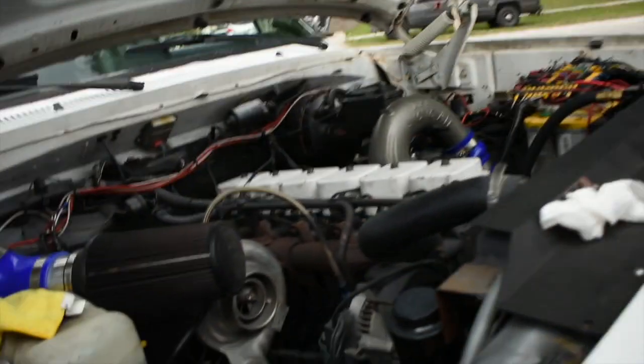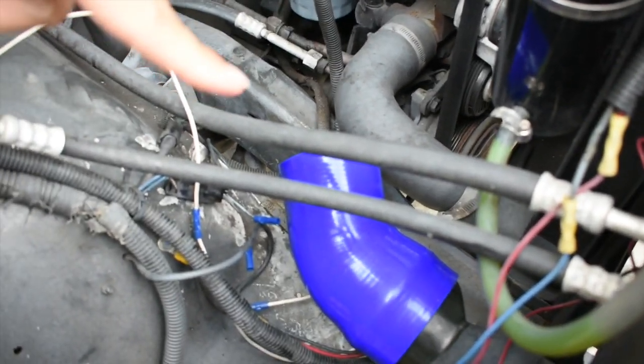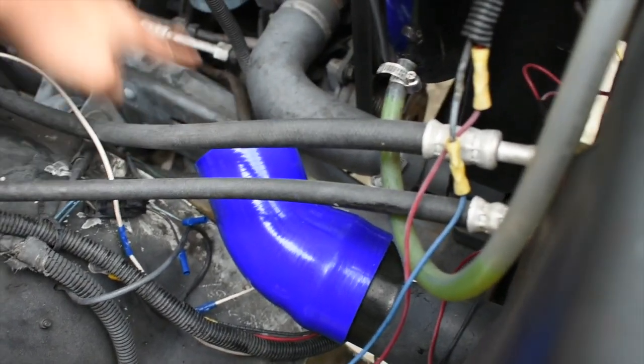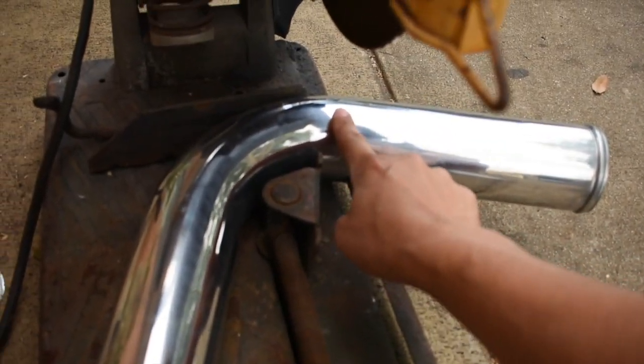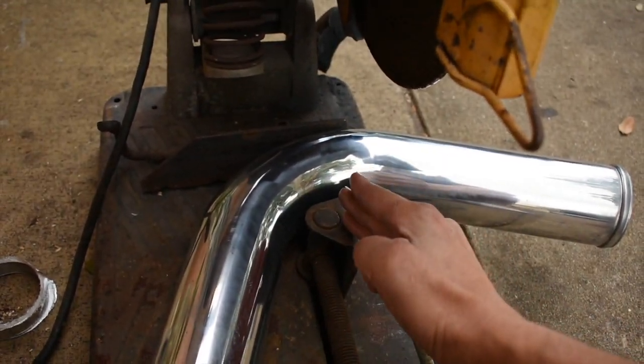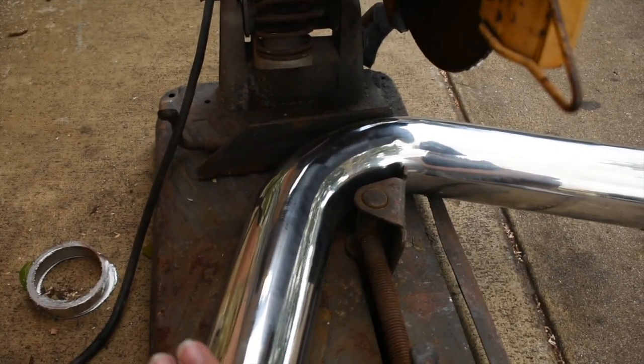Alright then, so we were able to put that boot in there. I did have to take the screws off of the fender well so I could put that in there, which was a pain in the butt because it was really tight. I went to get another intercooler piping I had inside the attic, so that this can curve into here. Since it has a slight curve, I'm gonna try to cut it somewhere around here, and that way I can easily cut it back down if I have to. But I want to make sure I have enough because I didn't bring another pipe like this.